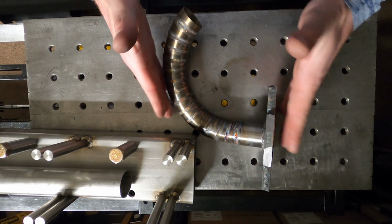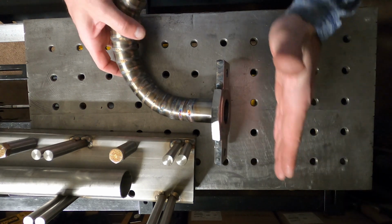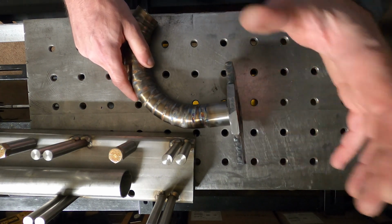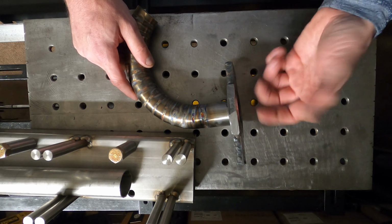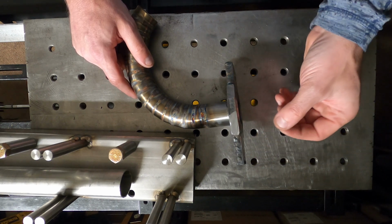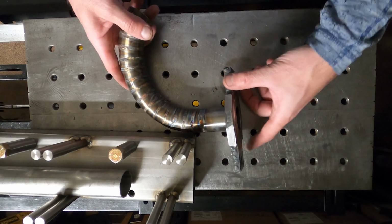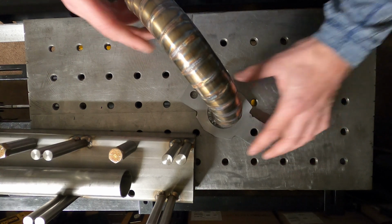But the pump basically cleans off cavitation. The pump will have its own volumizer in between the part that we're cleaning, and that'll keep the pump primed. At the same time, at the other side of that will be an engine part, and as it pulls the carbon out of that, it'll create low pressure effects behind it, or in front of the flow path, and essentially use the carbon as, you know, sacrificial material. So it'll eat all the carbon off of it without chewing up the pump. So I need something that can maintain pressure, and this is what I came up with.